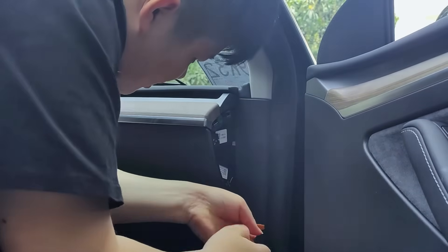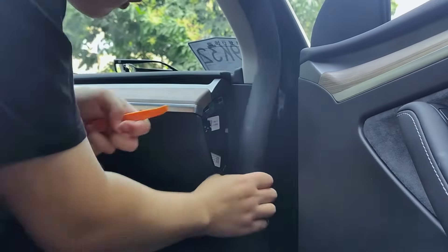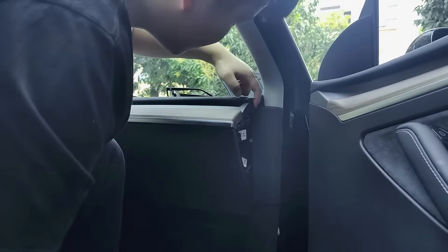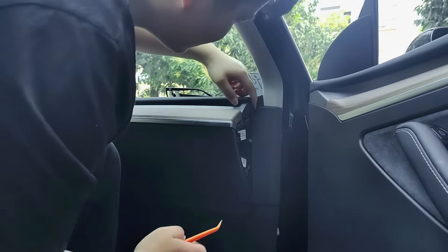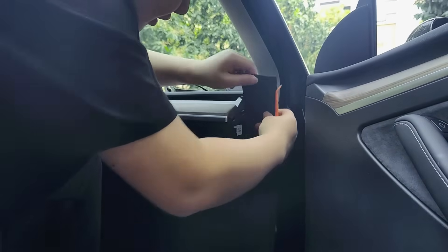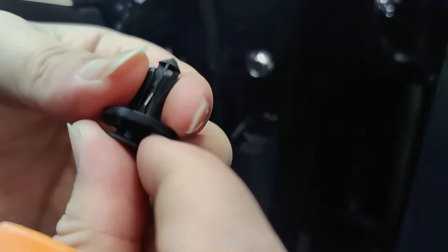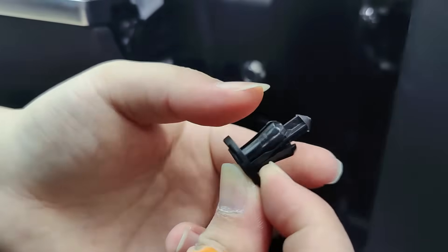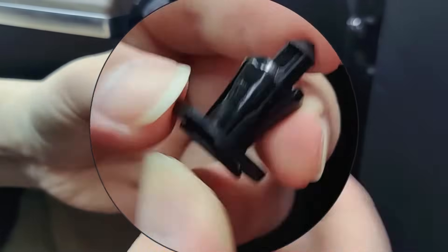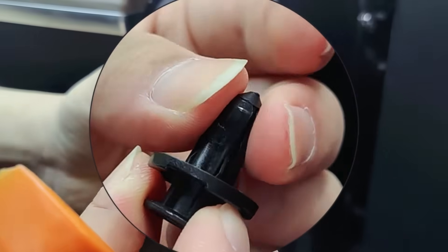What you need to do is disassemble and use the yellow wrench provided by the manufacturer to pry open the protective casing of these wiring lines. See where my fingers are squeezing — hold the upper part and then pry the threshold strip. The door sill weatherstrip has a detachable clip with a fascinating physical structure. By prying the upper part with a wrench, the lower part will contract, allowing you to easily remove it.